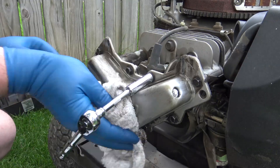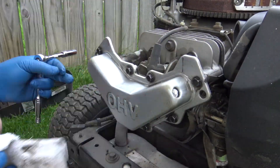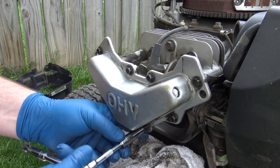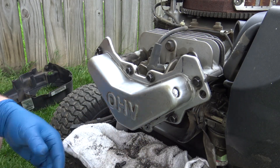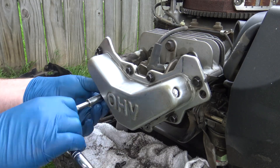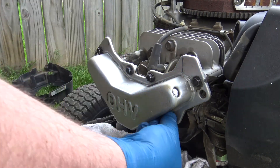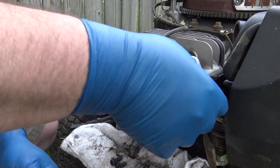The next step is to remove all the screws from the valve cover, one after another. You take this hose off — you can just pull it off — and put it to the side. Then remove all the screws. For this part I'm going to fast forward because this is not very exciting. Just be aware there's a little oil in there — it will leak out about a tablespoonful.